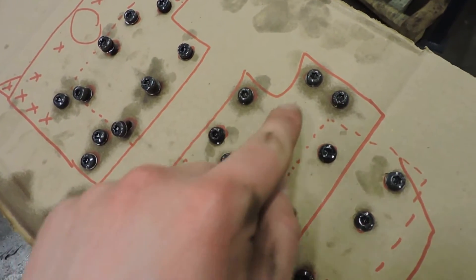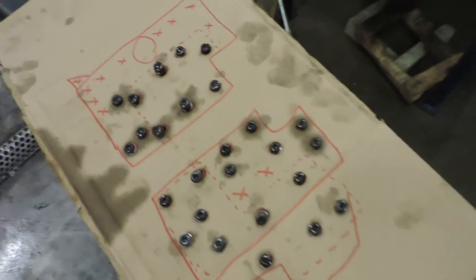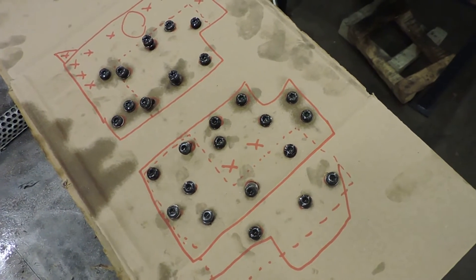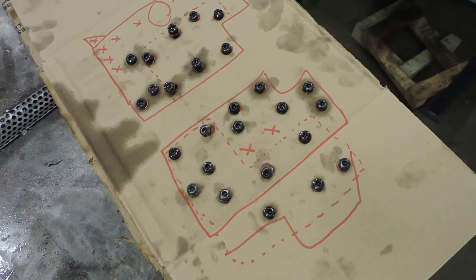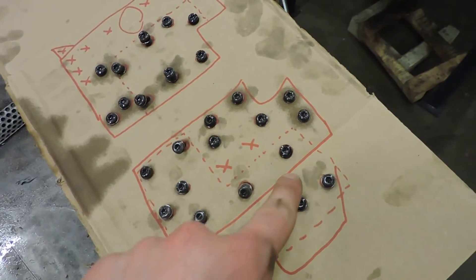Take this part with its three bolts. Don't torque them to any spec — not 5 or 10 Nm, don't even go there. Just put them a little bit tight so the valve body plates stay on the main channel plate. Once you've done that, you can flip the valve body around, position the two plates, and then bolt everything together.